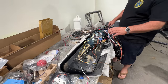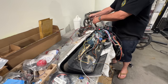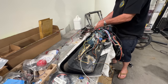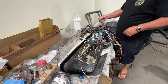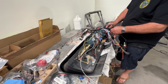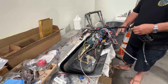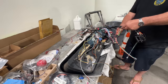I can actually look at the stock harness. Let's see — that's where the brake pedal is. I see no provisions for any — oh, here we go: pink with a brown tracer, all the way over here. New brake switch.